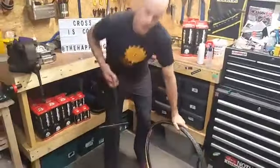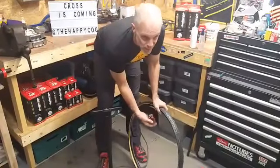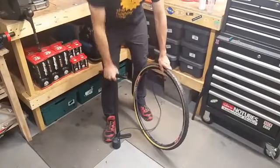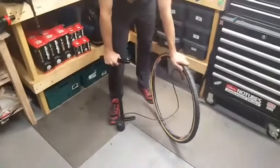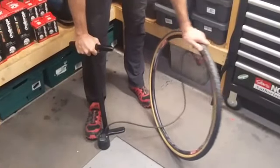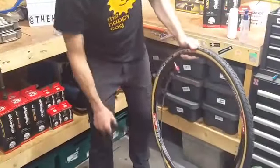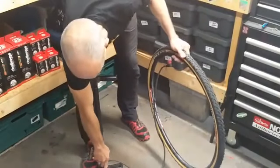Just to show it's not a fluke, we'll put some air in. At cross we'll be running 19, 20 PSI — maybe 21 on the back for the cobbles. There are courses where you might want a bit more gas, like Strathclyde, a bit more air because of the rocks, but 19–20 PSI. Pump it up. Remember when pumping these things, take your time, because if anything does go wrong it's going to be loud — I had one of these explode in the back of my van on the M8 last year and thought somebody chucked a brick through the window. Keep pumping until you see an even space between the rim and the black, so the sidewall is all even. You might hear it go pop — it's just the rim and beads sorting themselves out.